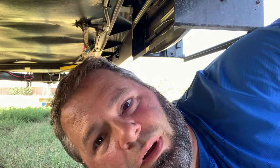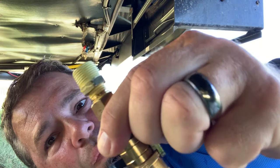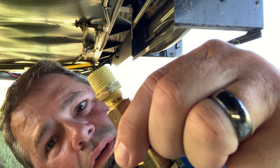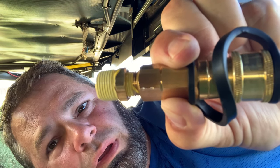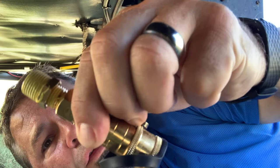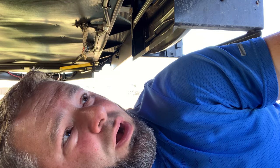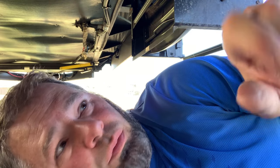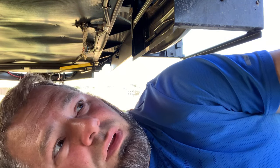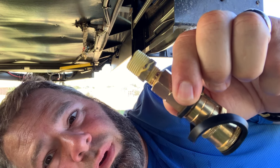We are in position under the RV here. I just got my fittings taped with the propane Teflon and got all those little pieces put together. Our 90-degree angle, which goes into the junction box, I taped it as well and got it started, so now we just have to tighten that, add this to it, and then the quick connect is done.